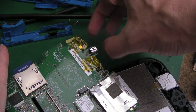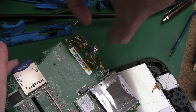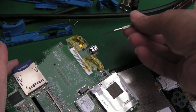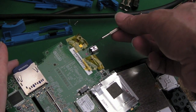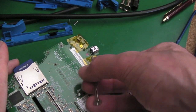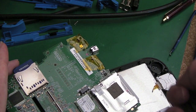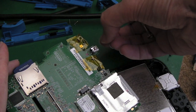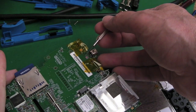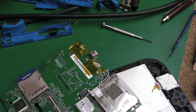But as you can see, hopefully, it's slightly crooked. It's kind of pointing down this way a little bit. The whole thing had a massive knock when someone plugged in the charger and it fell off a table and landed on the end of the cord. So it bent the connector and ultimately broke the connections off. That's why we reflowed them in the previous video. That's a quick fix. We tried to straighten out the socket a little bit, and we reformed it with some pliers. So whilst it is working and has been reliable ever since, we just want to replace it. I wanted to show you both ways.